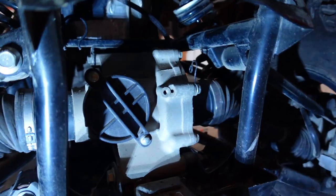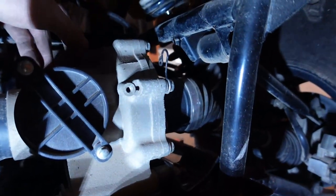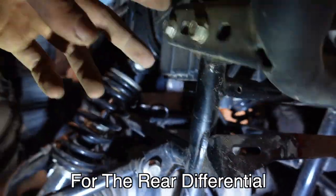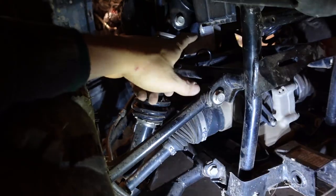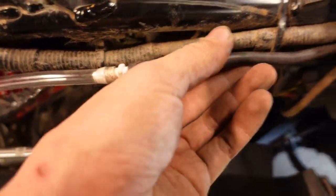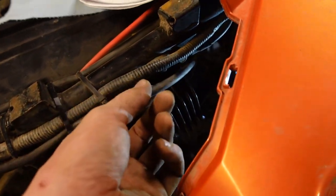All right, so I just got done running all the vent lines. There's only three you have to run, which is nice. The factory vent line, which is right here now, starts off here, but usually comes up and runs along the frame rail, and actually goes up under behind the light here, which is kind of odd. But basically I pulled that out, pulled it around this way, and made a connection with one of the couplers here. So it's just coming right up and around here.